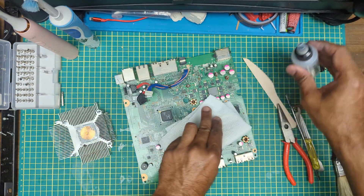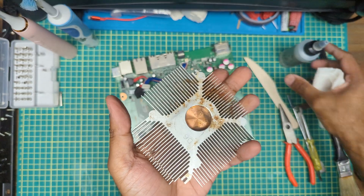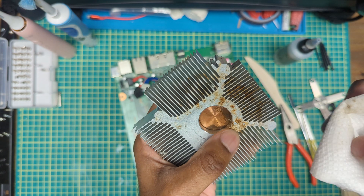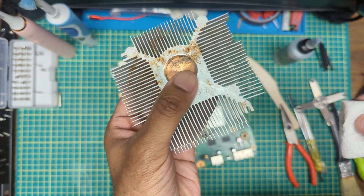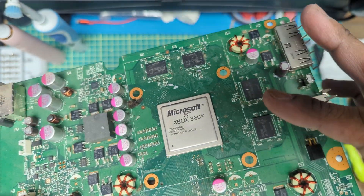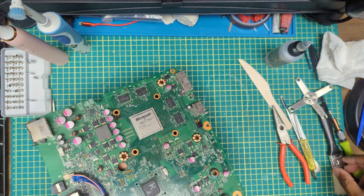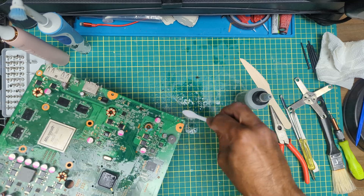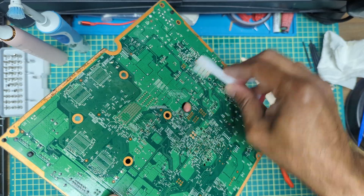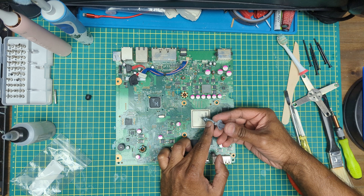Let's get this cleaned off. I'm not sure if there's anything we can do about the corrosion — I don't think it'll corrode more, but I'm not sure why it corroded in the first place. The fins are clear. Before putting the thermal paste back on and the heat sink fan, the board itself is a little filthy so I'm going to use some isopropyl and the toothbrush to clean this off. I'll do the back as well, hopefully not removing any structural dirt. Now to get some thermal paste on — this is just Arctic Silver — let's put on the thermal paste and pop this back on.